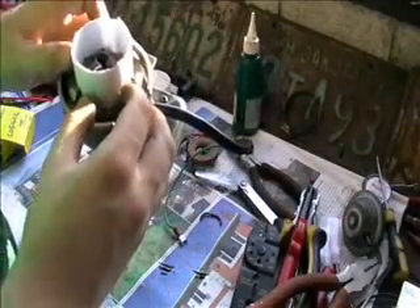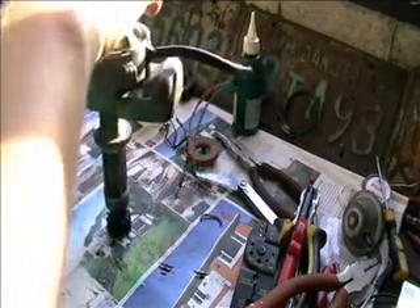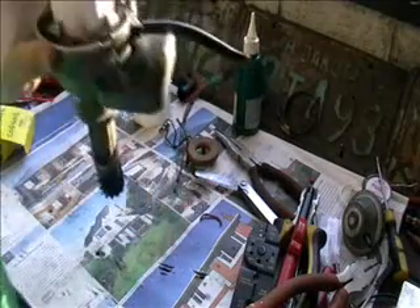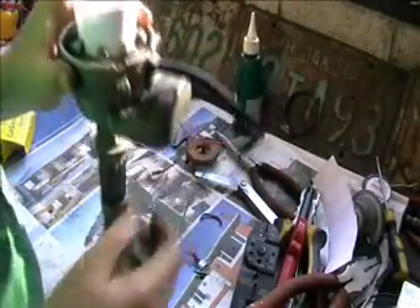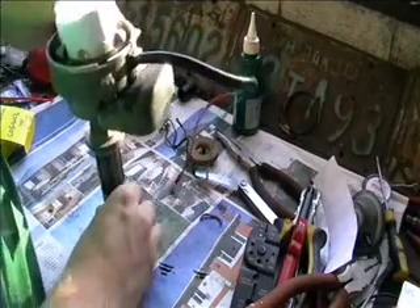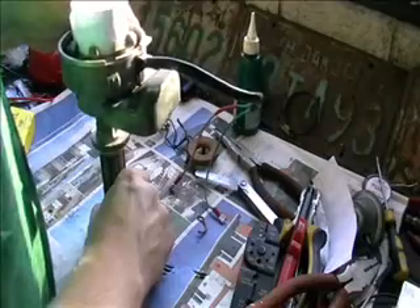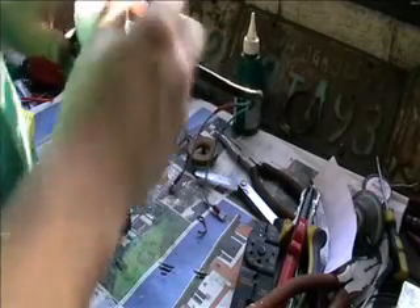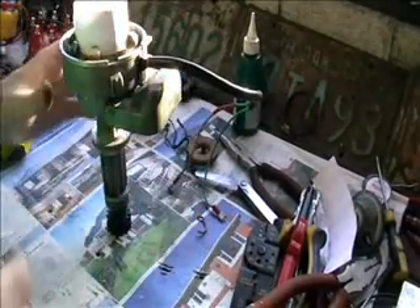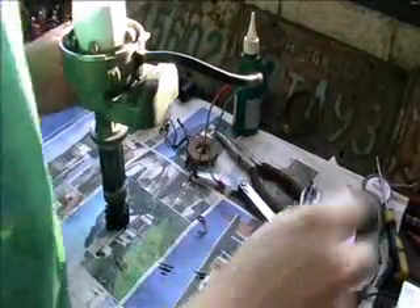So, if I put that there — just bear with me. All right, we've got our four pieces of paper in there. Now, line up the reluctor — the points on the reluctor with the points on the stator. It might only want three sheets of paper by the looks of this one, so just experiment until it's tight. Three sheets of paper in there. There — I've got all the points of the reluctor hitting the points of the stator with my air gap.